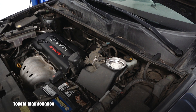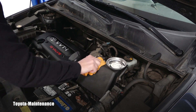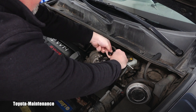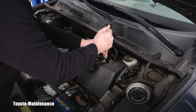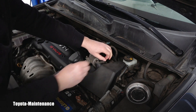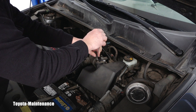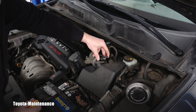I'll take a rag and wipe it off. My next step when I deal with it is to disconnect the electrical connector — push on the tab and pull it away. It's held with these tiny screws. Always make sure you don't lose them, because if a screw falls somewhere in the engine it will take time to find, or you may never find it. Put them on a magnet, and voila — the sensor should be loose and able to come out.